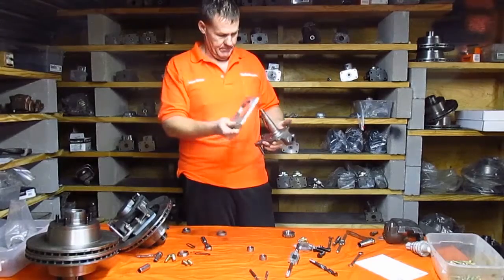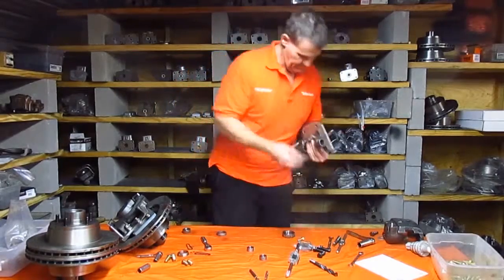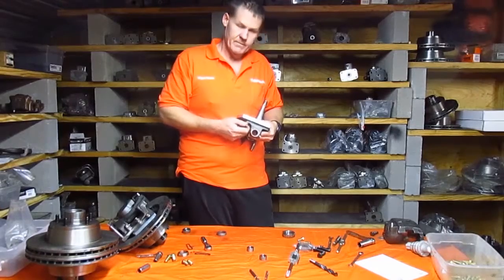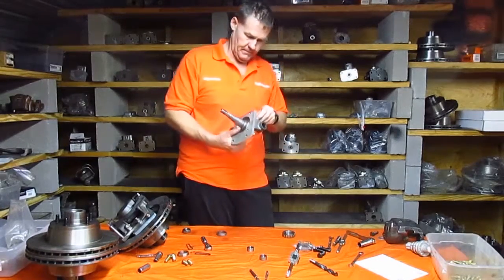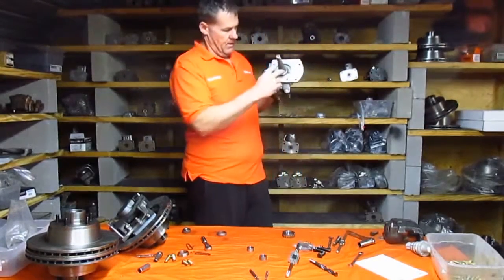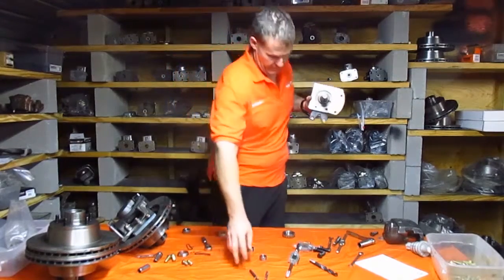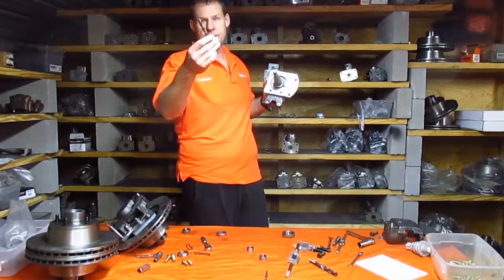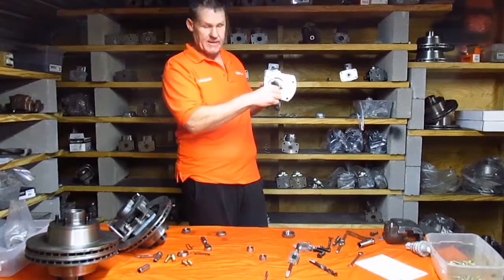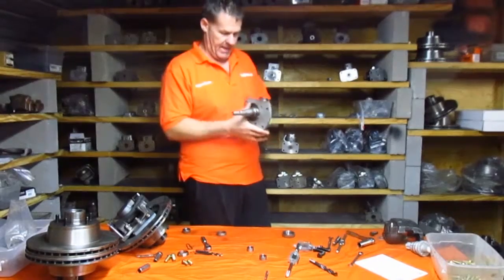Take your plate and bolt it up so we can get a pattern and a mark. Here's our pattern for our two new holes in the spindle. All we've got to do is take a 25/64 drill. Using the plate, we can center it, mark the holes — zap, zap — and know exactly where they need to be.